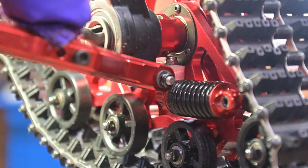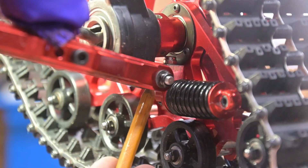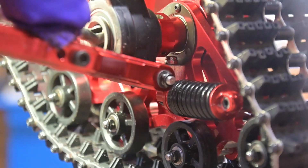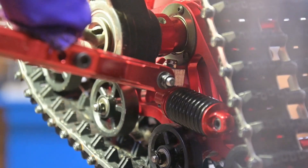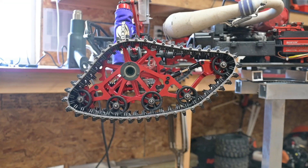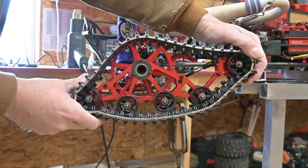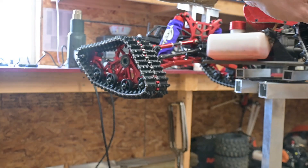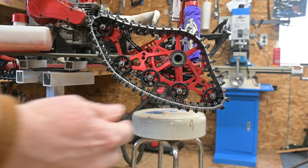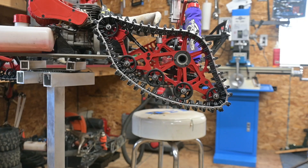I got the part fitted up in there and it does drop the tracks back really well. I'm going to have to put a little ledge on here to lower the nut down to make sure I clear the hex nut and the little plate inside. Now with the spring adjusted and the leverage changed, you can actually flex these tracks and they will roll over terrain — you don't get that with the stock ones with that tight spring. There has been a huge change in how they sit now. That's the new arm and you've got nice flexing going on. The other side is still sitting like it's on the launch pad ready to take off, with the original setup — you cannot get that to flex at all, that spring will not compress. So that actually ends up working out really well; I'm pretty happy with that.